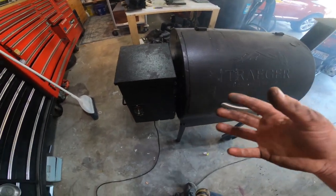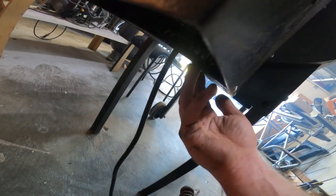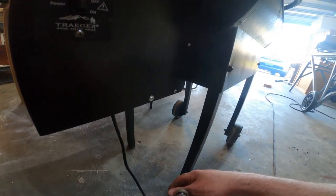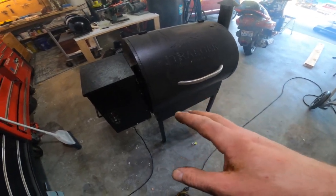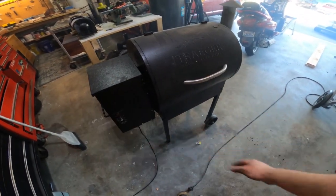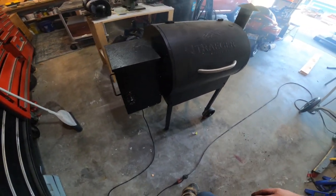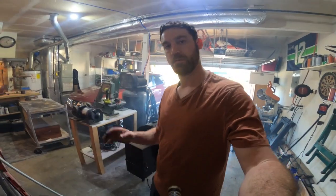Rather than pulling it all apart like I did, you can pull that tray off the bottom and just unplug the heat rod, plug it into your outlet, and see if it pops. If it doesn't, try another component and use process of elimination. I went about it the long way just to show you guys how to disassemble and reassemble it. If you're doing this at home, you can just unplug the heat rod from underneath without taking everything apart, and see if it pops the breaker. Hope you guys enjoyed it and learned something. If you like what I do on this channel, please consider subscribing and hit that like button. We'll see you guys in the next one.